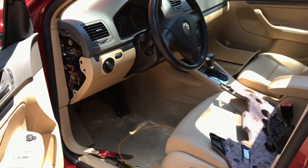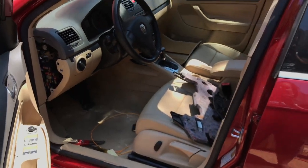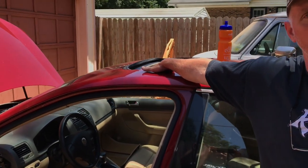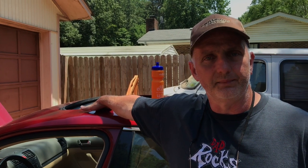I went to my dad's house and with some help, I was inside the car. Started hosing the car off from windshield level down, disregarding the sunroof — did not want to wet the sunroof yet. I wanted to keep those two divided. Really hosed it down good. Did not get any type of water leak until we went back up and started hosing down the sunroof, which I kind of figured was probably the culprit anyway. I just wanted to differentiate between the two.